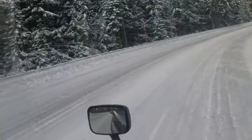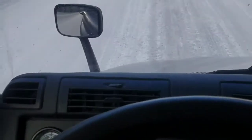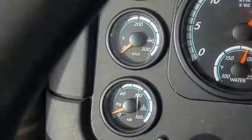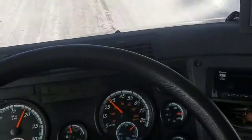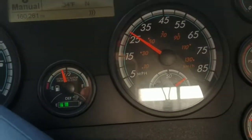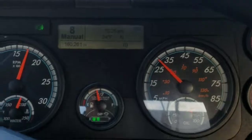I'm letting off again — give these brakes a second to cool down. Now we were off the brakes, and now we're going to just slightly build up air, feather-stab it there for a few seconds, get the speed down to about 25 or so right before the sharper turn. Now we're just going to let off the brake so we're not getting hot, and we're going to start picking up a little speed, still letting the brakes cool.